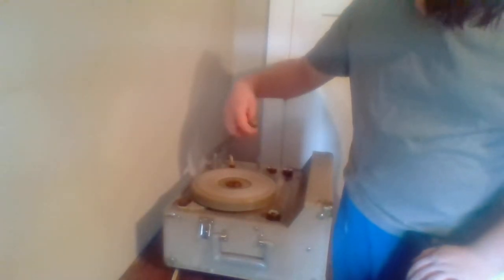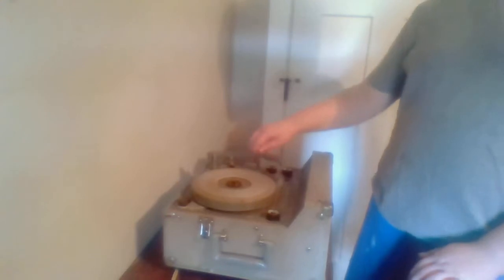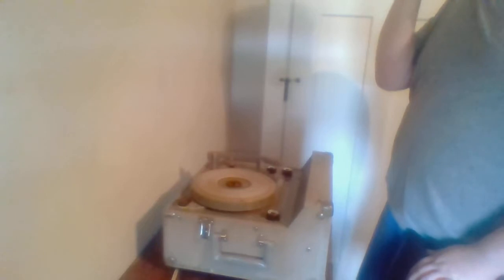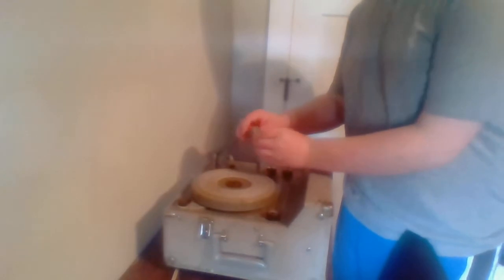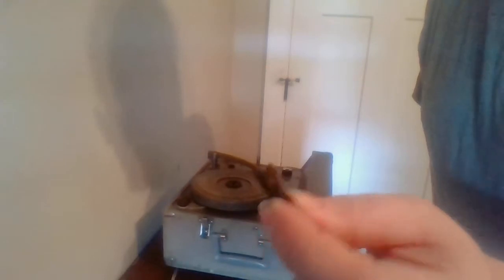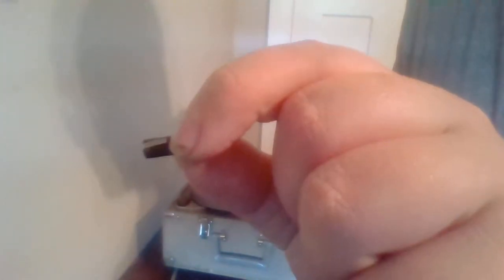The needle that was in this was completely and utterly destroyed. It's a magnetic cartridge in this one — it takes magnetic and ceramic. It's a bit unusual because you can't just replace the needle like a cheap Crosley where you snap a new needle in. Here, the whole cartridge comes out, and I can show you that. This is the entire needle cartridge — you can see the two pickups there, and you can see where the needle sticks out on the top. It replaces the whole cartridge. And it has a dual needle: a 78 needle, and then a 45/33 microgroove needle.